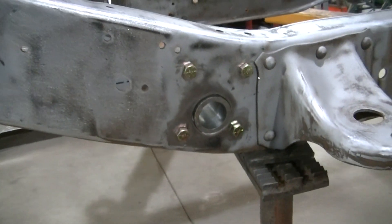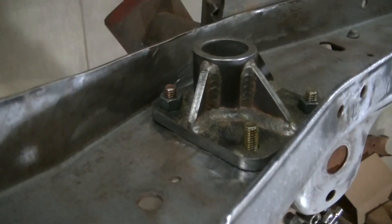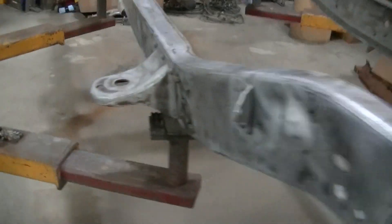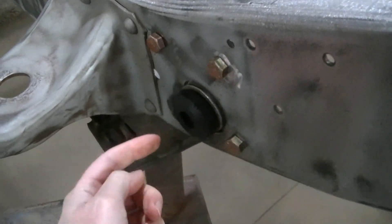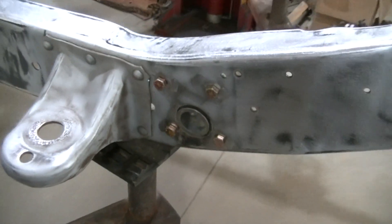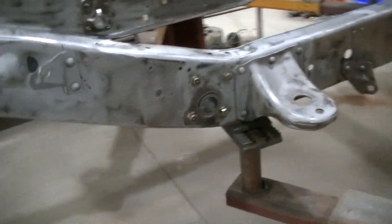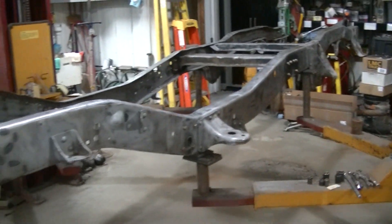There's a look at the final install once I cleaned up the hole. Got both sides done. Your bushings go in there, then your sleeve, and then you bolt your shackle to that. I don't want to install all that because I've got to paint this frame. Hopefully this helps some people out. That's going to do it for this video - stay tuned. Next video will probably be painting this frame. See you guys.